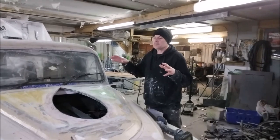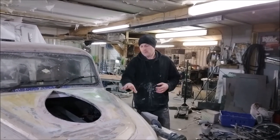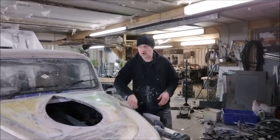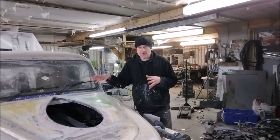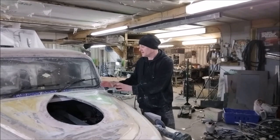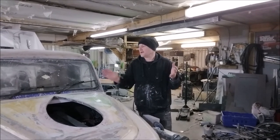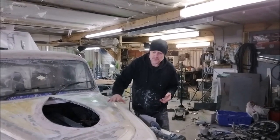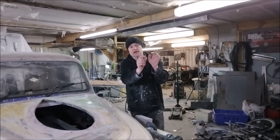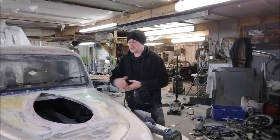And what will be the next step for this now will be for the whole thing to be covered in one sheet of fiberglass, resin down. I'll probably go over it twice. It will just take the flex out of it so it's rock hard, and make it a lot stronger. At the minute what I'm doing, I am filling it to get the shape, but this filling, I'm grinding through the component pieces of it. But because my framework, there's no metal, everything's plastic, I can grind right in and make this whatever shape I want. And I'm just putting the filler on so that when the fiberglass goes over, I don't want the fiberglass to be bridging with a void behind it. I want it to go over the whole thing, mold nicely to a clean sort of shape.